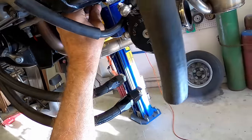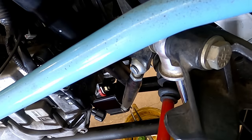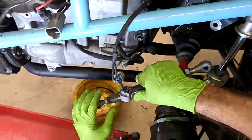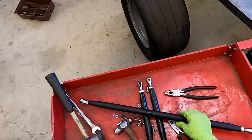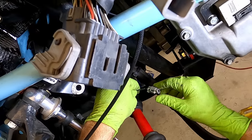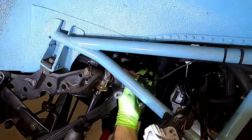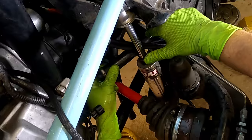Remove what are known as the dekaffer bars — you only have to remove the two rear bars and the top bars. Underneath the intake charge pipe is the air temperature sensor; unplug it. It's buried in there but actually easy to get to. At the point where the trans meets the engine are two dash-6 fuel lines — have caps and plugs ready to go. These are the two water lines to the intercooler; disconnect them at the splice section.